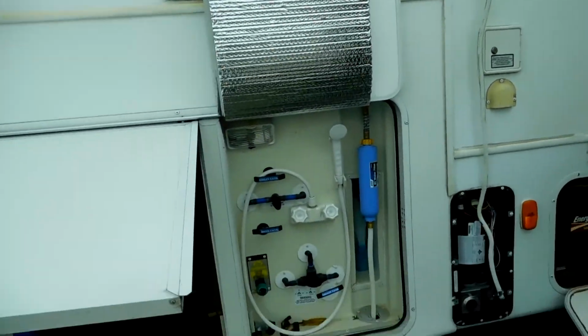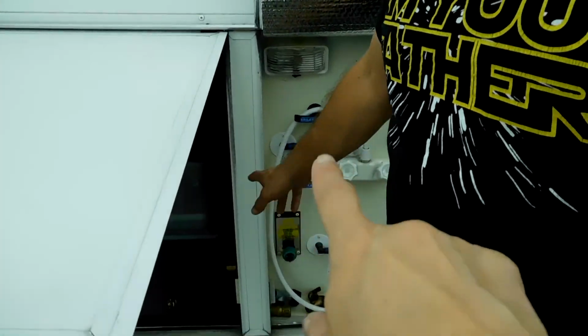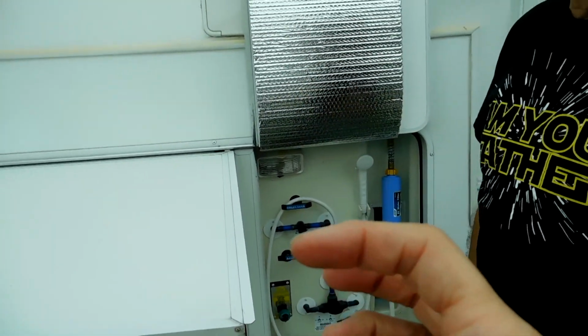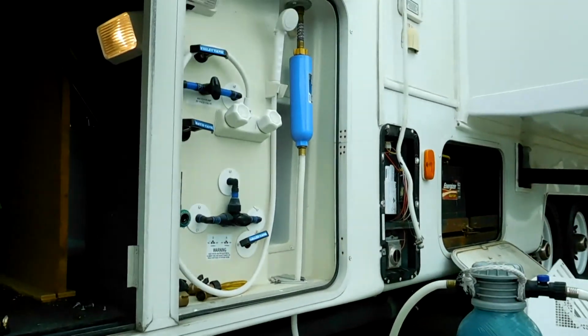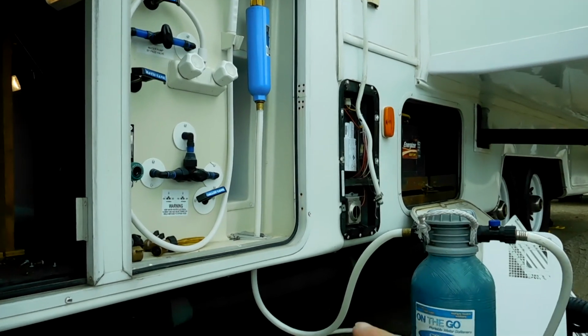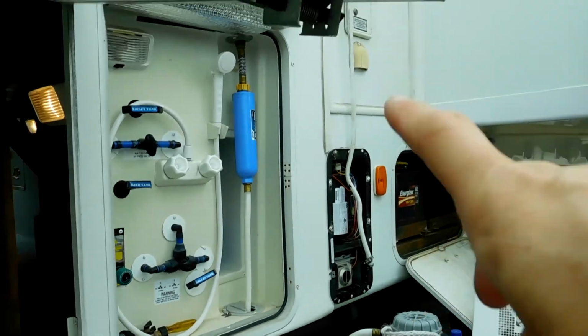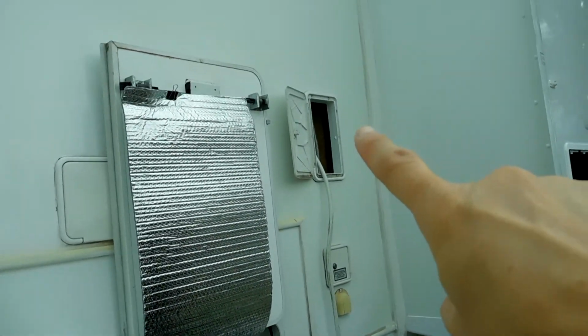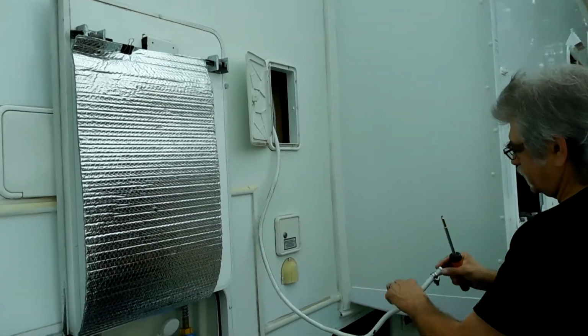Yeah, but we were trying to figure out where the water was coming from. We had them fix our water pump because there was a leak at the screen. So they replaced all that, fixed all that. And then looking right behind this water compartment, there's no water right there. And the water coming from underneath was coming directly above the furnace, right below the furnace area. And it was like, okay, so what water source do we have there? And so I opened up that compartment and started pulling the hose out, and as soon as I pulled it out, it sprayed me right in the face.